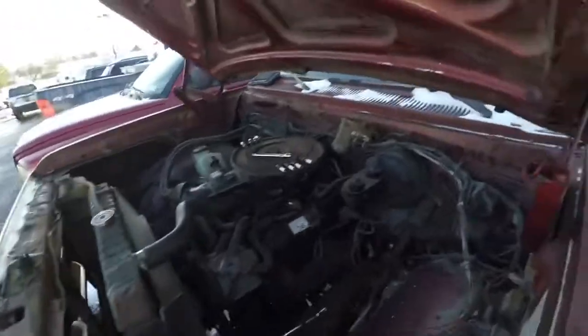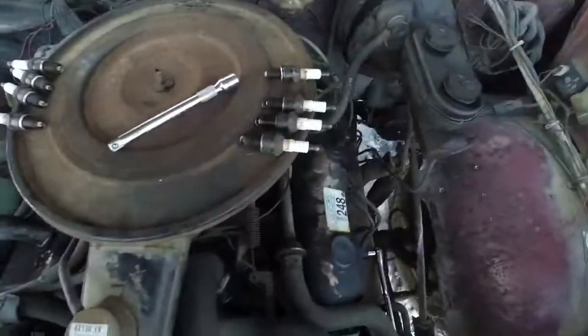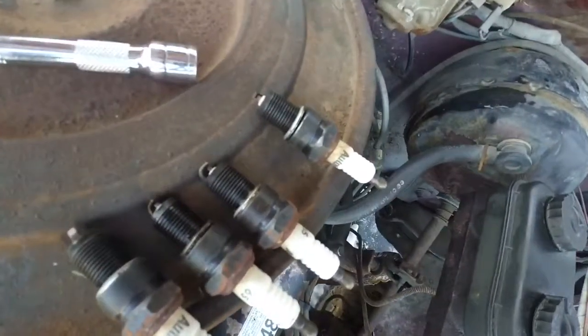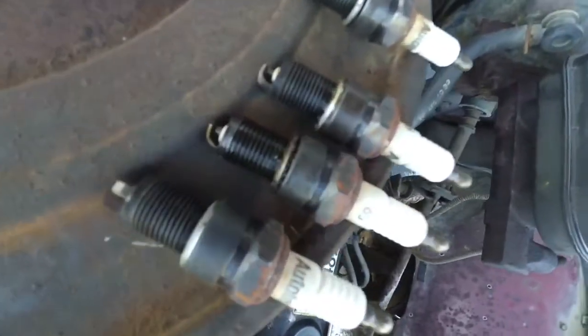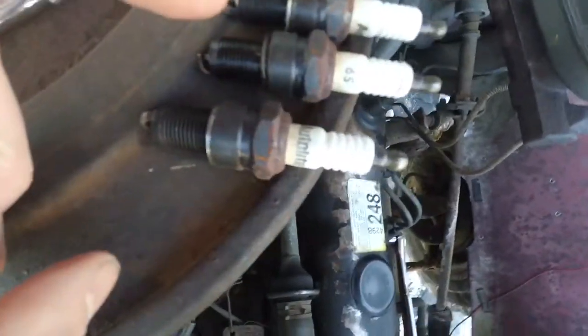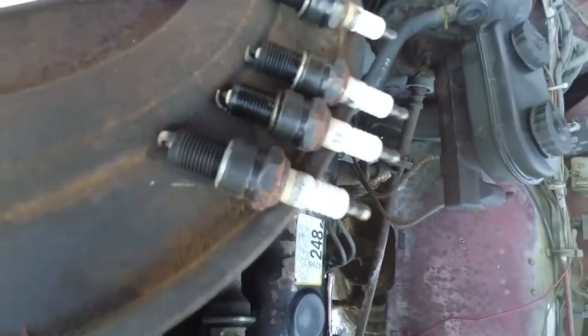A really cool guy just came over and chatted with me about the truck and offered to give me some stuff to use for the plow on the front, which would be cool if I ever choose to plow with it. Got to love other Mopar people. So here are the plugs — really pretty clean all the way around, very consistent, they're all looking about the same. The number three over here has a little bit of oil on the threads, a little bit more than the other ones, but not totally a cause for alarm because the tip still looks pretty good. So far it looks like it's checking out as far as how it's running.